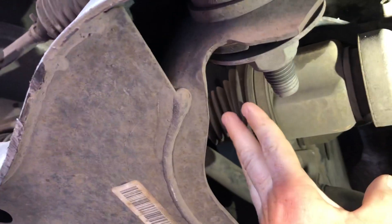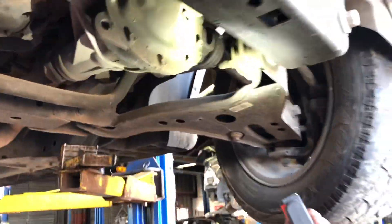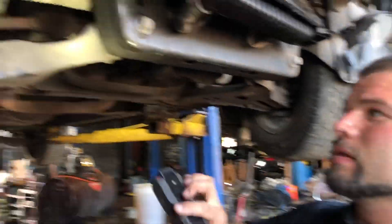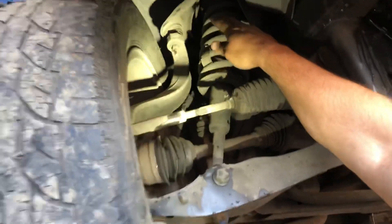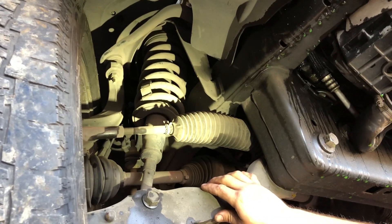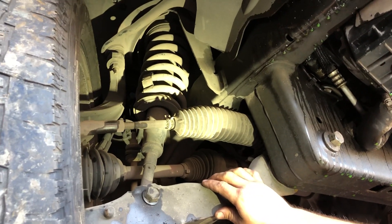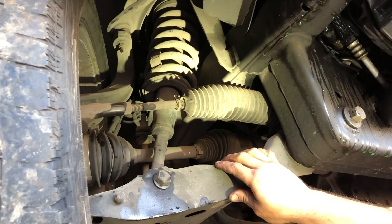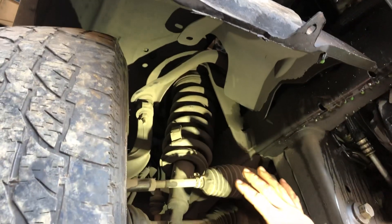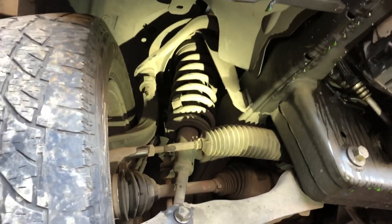This 440 carries out 447s here, which are not part of the 440 assembly typically. So you have four 447s here, left and right. The main components here are going to be the ability of the vehicle to operate independently on the left and right wheels. We have our upper and lower A-arms that operate separately on both your left and right sides. You'll hear that a lot from your customer — 'I'm looking for an A-arm for an Explorer' — that's just another way of saying control arm. This can be inventoried independently as separate items or as one 510, or what we call a knee. So it could be a 511 and a 512, or it could be a 510.